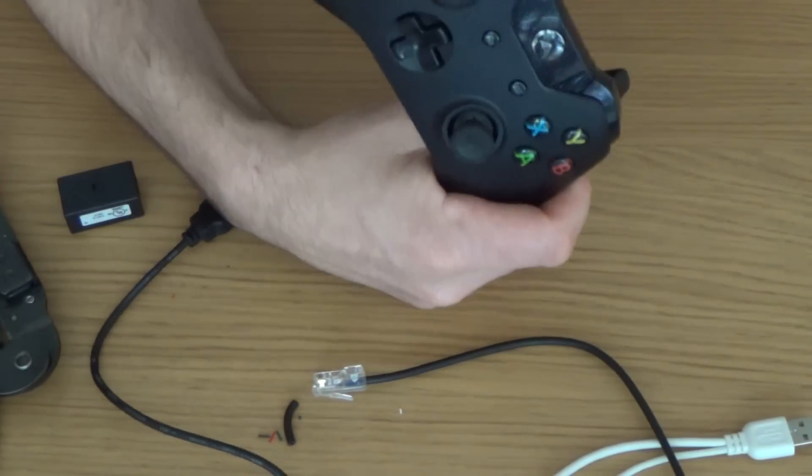For the Xbox we're going to need a micro USB on one end, because the Xbox controller has a micro USB, and a male USB on the other. I'm going to bring the camera over to the Xbox and use it via a 10 meter lead. You might also want to use this for charging your phone, a mouse, or a keyboard — for example if your computer is hidden under the stairs and you want to use Netflix or Now TV on your main TV and already have HDMI wired up but just need USB out. If your house is already networked up, this is quite handy.